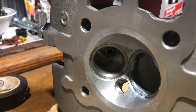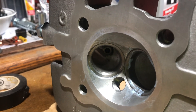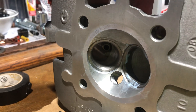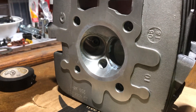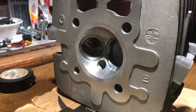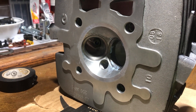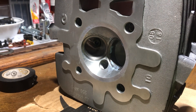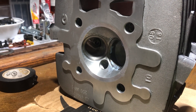Real quick, you just want to lap the valves. In China when they built this bike, they didn't do this. You could technically get away without doing it, but why bother? I hope this helps. If you've never done this before, I really don't recommend doing it with a drill — it's more tedious and you could potentially grind the valve out of spec. Have a good day, thanks for watching.